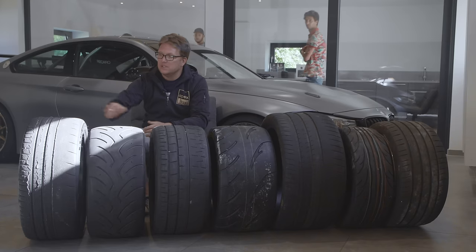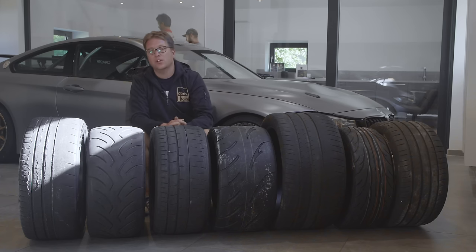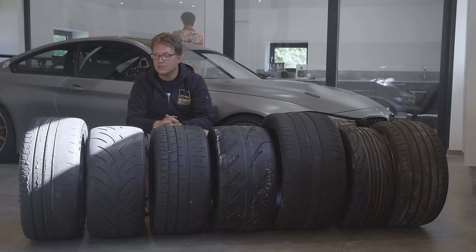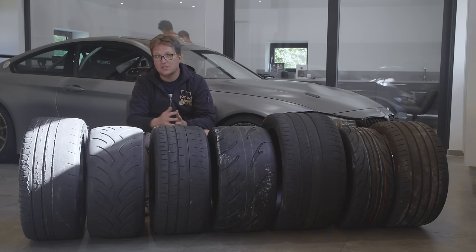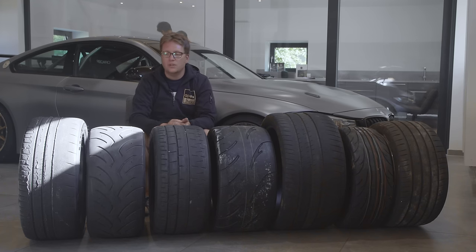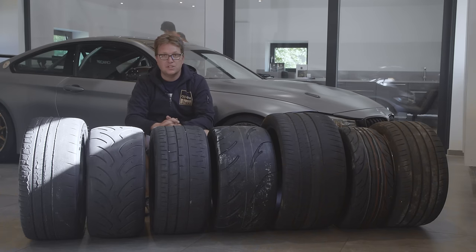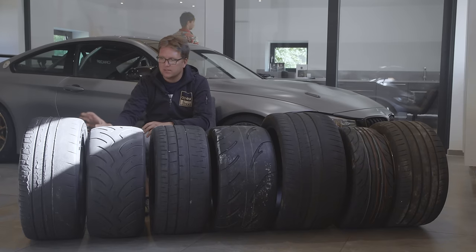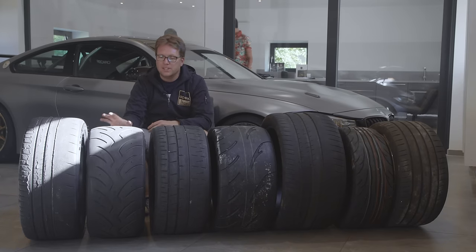The Cup 2R — I call that a qualifying tire. It's a very, very fast tire, very robust in the sense that you can do very fast laps on it and it doesn't fall apart. It gets used up quickly but it's a very safe tire and a very quick tire. The compound is very soft; it is a two-piece compound. For us, that tire is literally for when we want to go out and test how fast we can get our GT2 RS around the track — testing what's possible for taxi laps, what our safety zone is, how fast we need to be. It's got a very nice stiff sidewall and that gives you really good feedback.